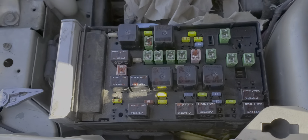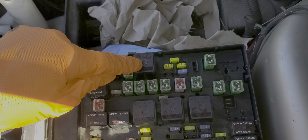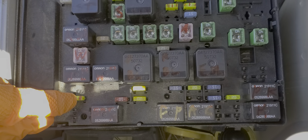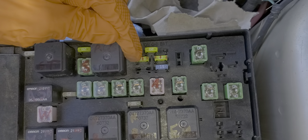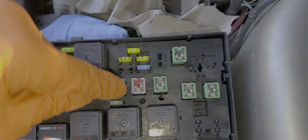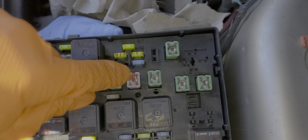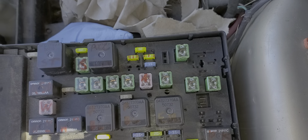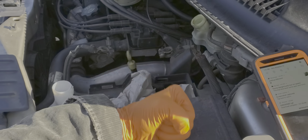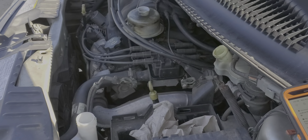I hope all this information was helpful for you. Just to summarize: we've got our relay here. There's a 20-amp fuse that powers the relay and also powers your CD changer. There's fuse number five, which sends power to the head unit and amp when the relay is engaged. And there's our 30-amp J-case fuse, which is dedicated for the amplifier. Let me know if you have any questions or more importantly any advice about troubleshooting the radio on your Dodge Grand Caravan.